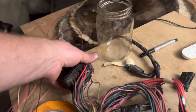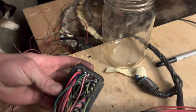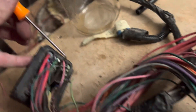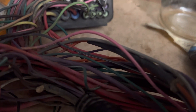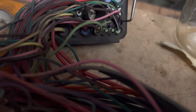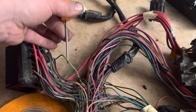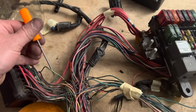This is the C100 terminal. On the back side, this light green wire right here — when you push the AC button, this light green wire is on D7. A, B, C, D — and this is 8, and that's 7. This wire is what gets 12 volts when you say, "I want AC," and you push the button.